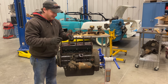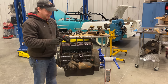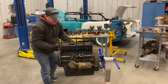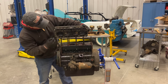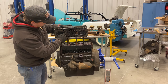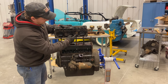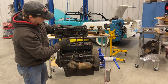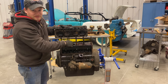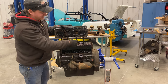It's really bad in here — I'll show you that in a minute. I definitely wasn't expecting it to be this bad. Let's take a look at the bottom of the head first. You can definitely see that we have some issues here — a lot of corrosion on these valves. Those valves are probably rusted shut. A whole bunch of crud is sitting in this cylinder as well. These two are definitely the worst. Looking inside the cylinders, I can see that this one is very rusty, and this other one — I'm not even sure what's going on in there.